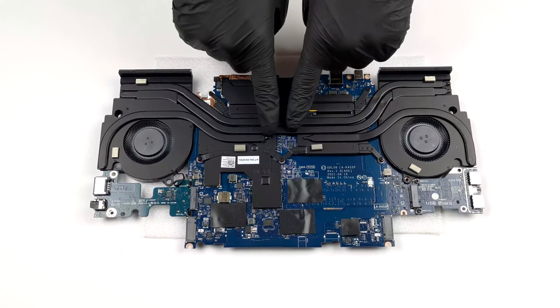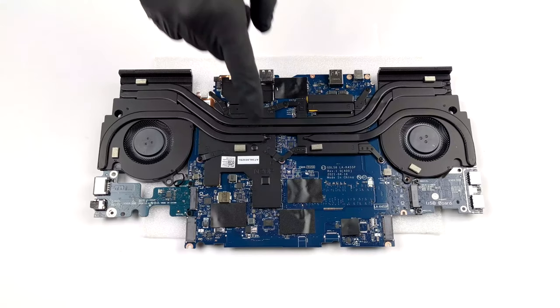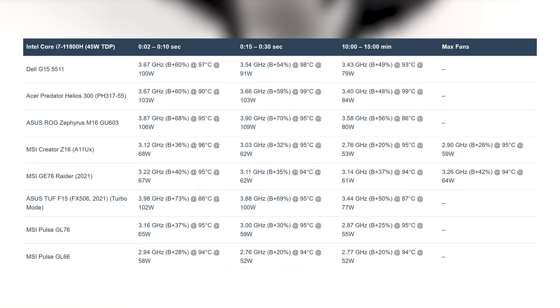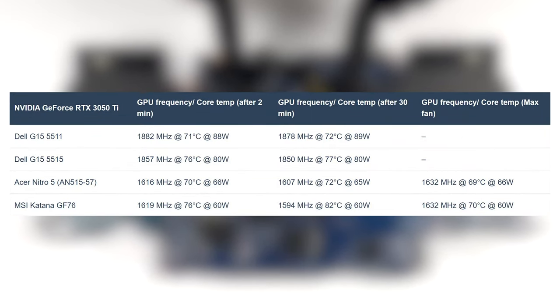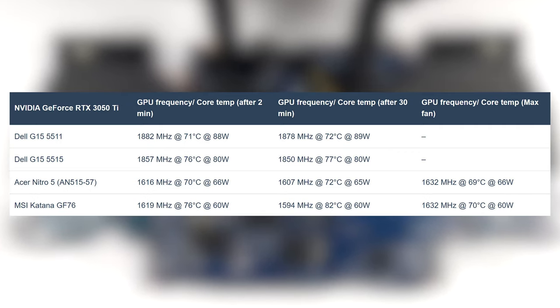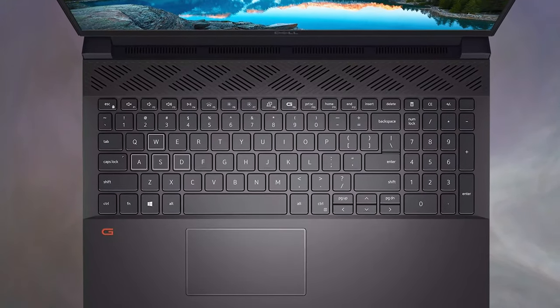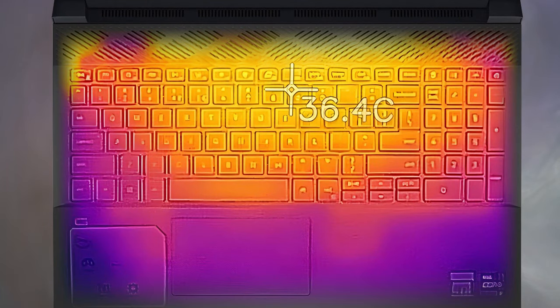At last, we've come to the cooling. It's got two fans, four heat pipes, and two big heat sinks, which provide ample cooling capacity. The Core i7-11800H maintained very high wattage and clock speeds throughout the whole test, at the expense of higher temperatures. Moving to the GPU, this is the best-performing RTX 3050 Ti, reaching 1,882 MHz and keeping a consistent 88W power draw. Comfort was excellent, as the large body does a good job at dissipating heat, leading to a hotspot of only 36 degrees Celsius. The noise was quite high, albeit we'd heard louder laptops.